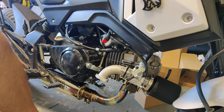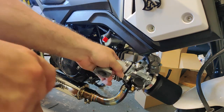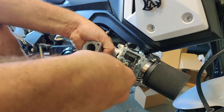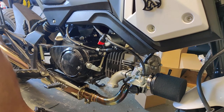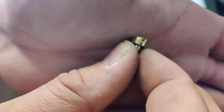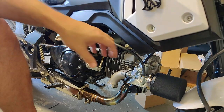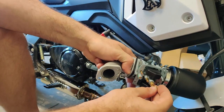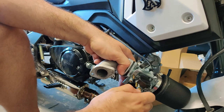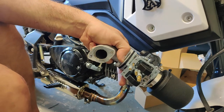This is saying it's a 38 but I don't really believe that — that would be absolutely massive. Most people end up running something like a 20 pilot jet in these. I think I'm going to start with a 100 main jet. I was looking for a 105 but that might be a bit too big. We want to take small increments to see if our changes are actually making noticeable differences, because if I jump up to the 105 too quickly I might miss the optimal step.